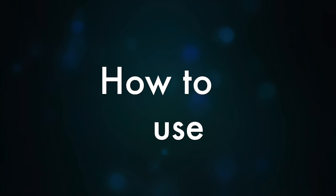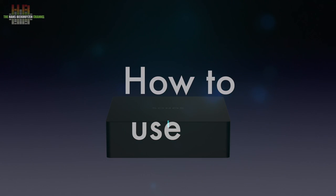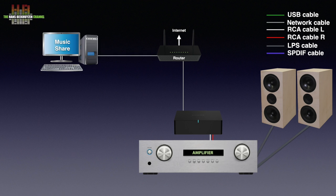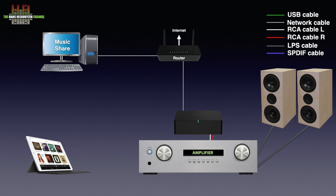Time to look at the Port and where it fits into your stereo. The Port connects via RCA cables to an amplifier and loudspeakers, and also needs to be connected to your network to access the internet via your router. If you have music stored on a computer or NAS, that also needs to be on the network and switched on during playback. The Port is controlled from an app on a smartphone or tablet. An optional simple remote lets you control play, pause, skip, and volume. The Port also has a stereo analogue input at line level that can be shared over the network to other Sonos devices.